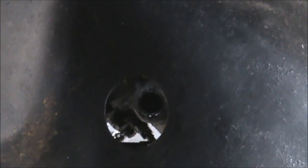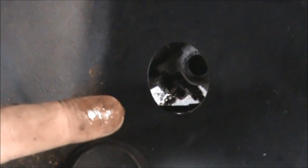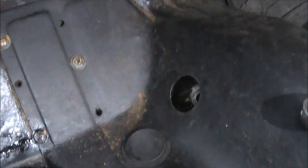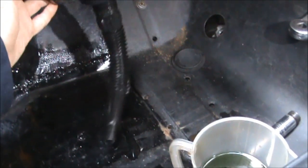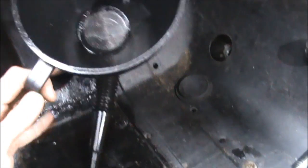I've released and taken out the plug. If you zoom in you might not be able to see particularly well, but there is oil in there — just not a lot. I'll very carefully pop my finger in — I can feel the oil is quite a way down. There's only a little bit on the end of my finger, so I am going to need to top this up. I've now been and got my oil in a jug to make it a bit easier to carry, and to get it in there I've got a funnel with a bendy flexible hose at the bottom which will go into the hole quite happily and I can fill it up from the top. In the top of the funnel there's a silvery mesh which is there to stop any large unwanted objects getting in — basically a little filter.